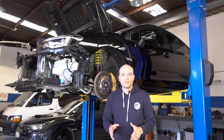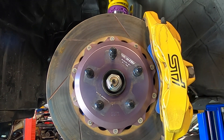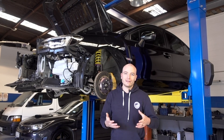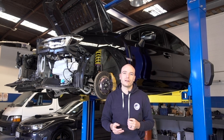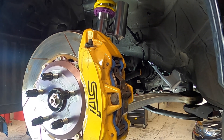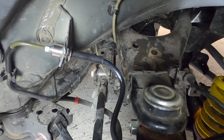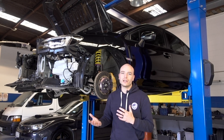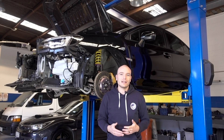The car already came to us with a bunch of brake upgrades, so we have floating gyro disc rotors. The floating design helps to reduce brake fade and the discs can stay hotter without cracking as easily, which is a good upgrade for a race car. We also have Endless brake pads and we've installed braided brake lines with a clutch line as well. Once everything's assembled, we'll run Motul RBF 660 brake fluid, which will make for a really good brake setup. In this 2018 STI we've got six-piston front calipers from the factory and they perform a great job.